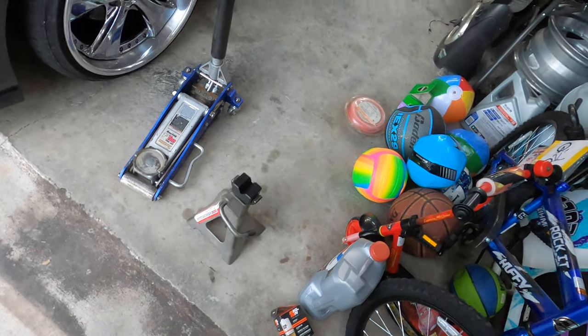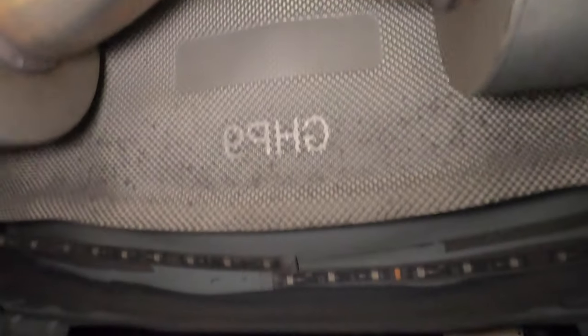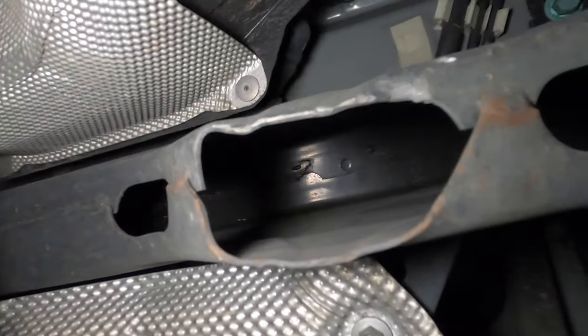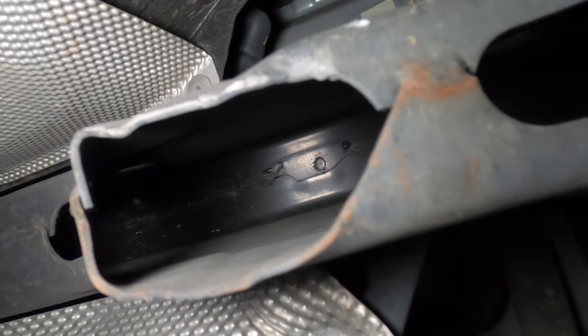The Mazda factory jack points — there are only two. Let me slide under there and physically show you. So we're under the car. This is your rear bumper, this is your exhaust — I have a Corksport exhaust — and this is going to be your rear subframe. You go past the rear subframe; it'll be offset to the driver's side, and right there is your factory rear jack point. Your jack has to go all the way under the car, past the exhaust and past the rear subframe to access it. About six inches toward the front from there is your gas tank, so make sure you don't jack up on the gas tank.